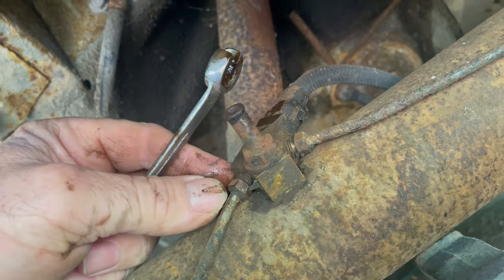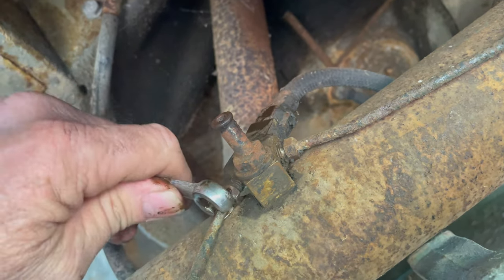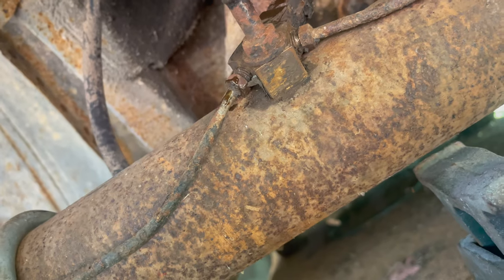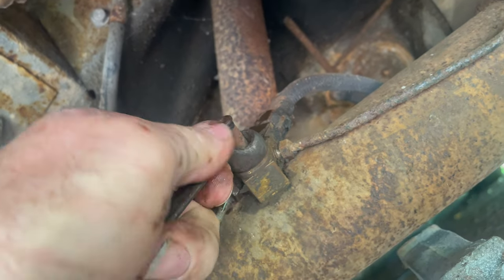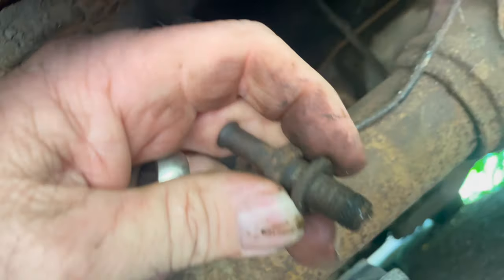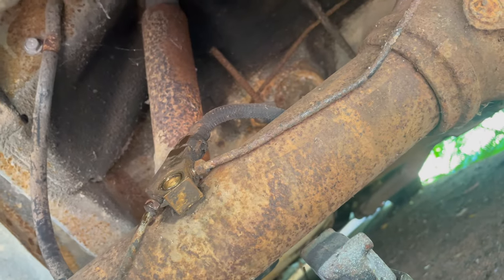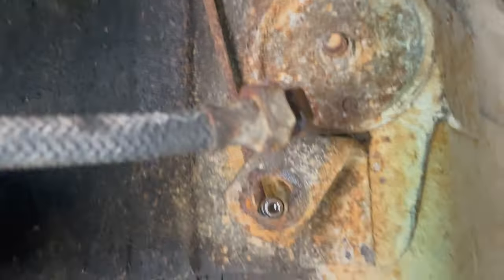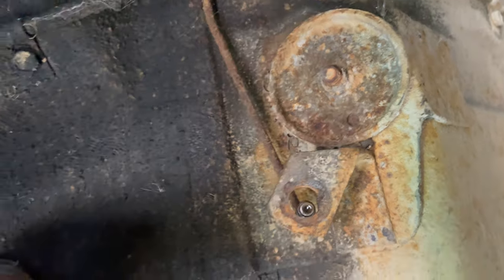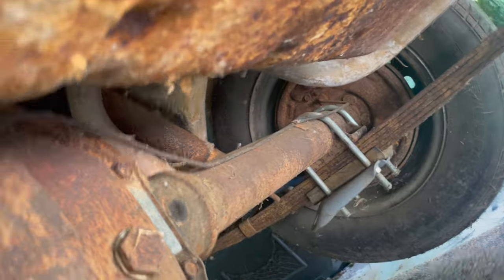Let's undo those lines. I'll crack on these while we're here. If I recall, that's nine sixteenths. I'm going to undo them in the vice because you can't get the pipe spanner underneath it. It does have a big crazy spring washer on it, so that's done. I want to undo this flexi line bit from the other end, from up here. I got that off without breaking it, which is nice. This pipe has had it - I'm going to try and get that line replaced.